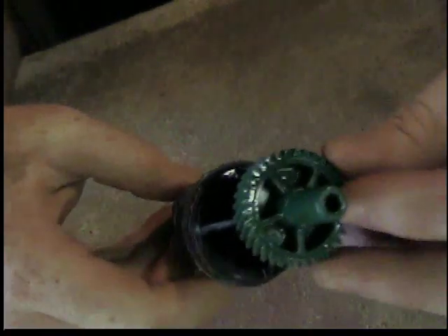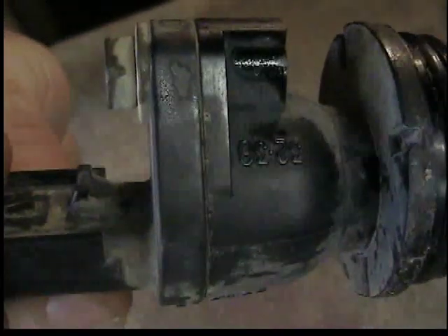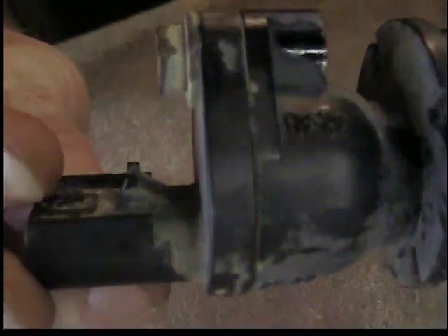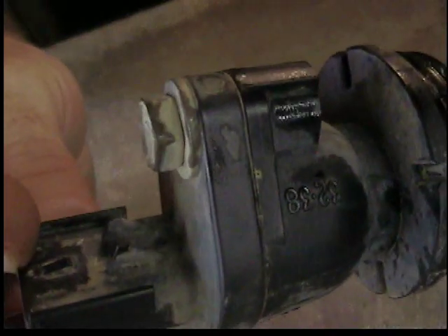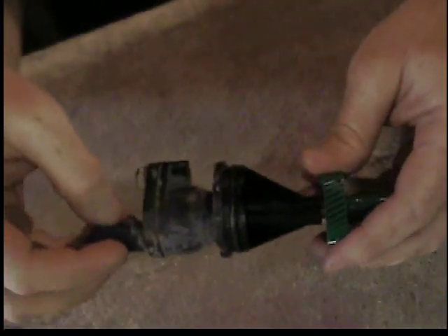Take a look — there's the gear. There are four sets of numbers all the way around this, because depending on the number of teeth on the gear you put back in, you're going to orient it with the right range pointing down, or at about 6 o'clock when it goes back in the transfer case. For example, there's a 32 to 38 range — so if you're putting a 36-tooth gear in, those numbers would face down at 6 o'clock when it goes back in.